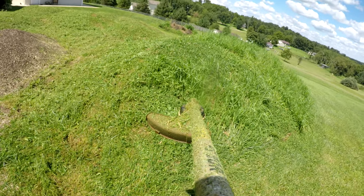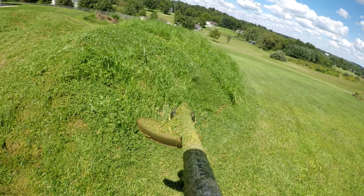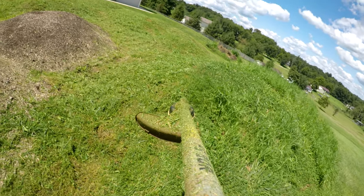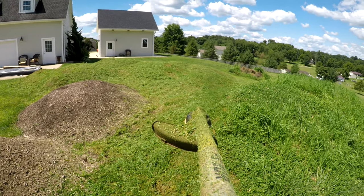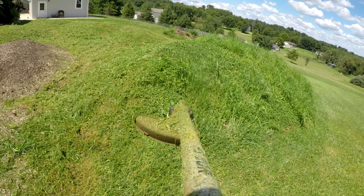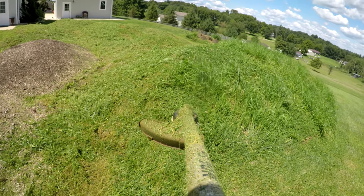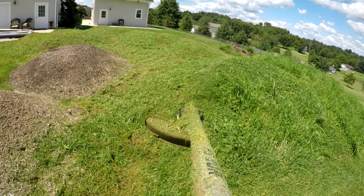You ever feel like your trimmer is down on power? This really only pertains to the 4-mix models. But if you ever feel like it's down on power, check your valve clearances. If your valve clearances are out of spec, it significantly harms your power output, and you can tell this by how the engine sounds when it's idling.